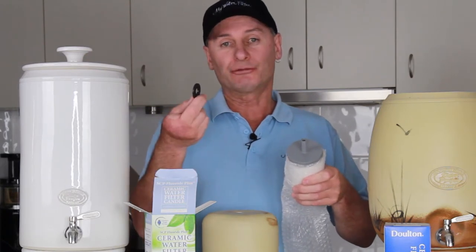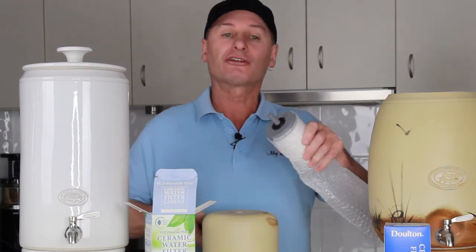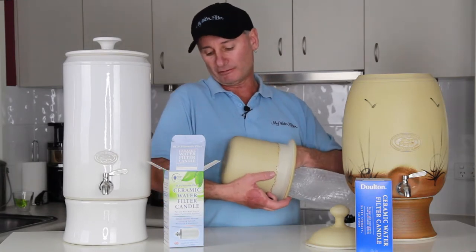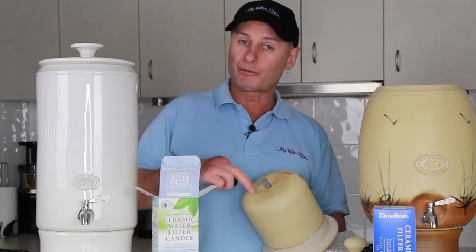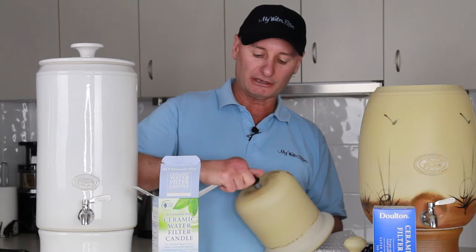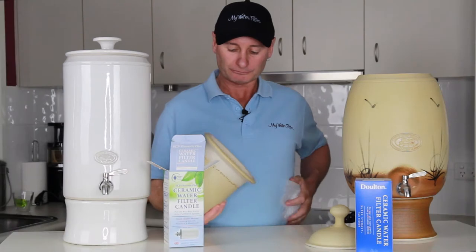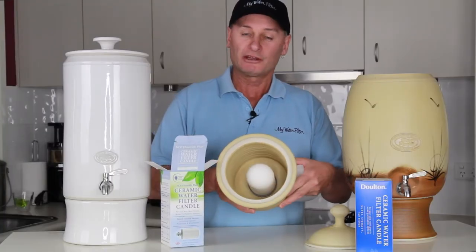Sometimes you'll get these and there'll be two washers in them. You don't have to have the second washer, but if it's there I would use it. One washer straight onto the stem of the thread, and we're going from the inside out. So this washer's gonna seal on the inside so no water can get past and dribble into the bottom tank — you definitely want a good seal at this point; this is where it all happens. So we put the stem through the bottom, then we get the nut and put it on. It's quite smooth on the bottom of the top tank, so the nut will spin nicely once it gets to the tightening point. Already tight — simple as that. On the inside you can see the nice SCP Fluoride Plus cartridge. That's ready to go.